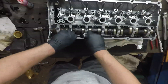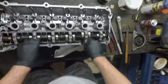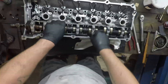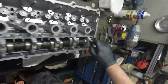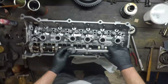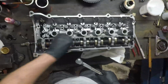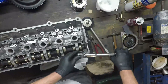This part is me putting in the intake camshaft — we've jumped back in time here — and I'm showing this just to demonstrate the torque process. As far as I've read there's no strict order to torque these nuts down in, but a lot of people say to go from one end to the other. I believe you want to take them down in an even pattern like with most aluminium parts. Set the torque wrench to 15 newton meters — double-check that for your own knowledge — and work your way along in a crisscross pattern or from the middle outward. This is crucial: don't go too tight or you'll crush the caps, causing them to bind on the camshaft. I start with the two caps that are tightest, then go back and check every one to make sure none have loosened off.